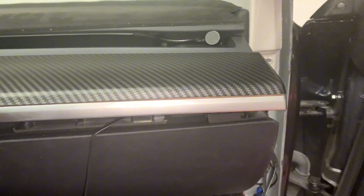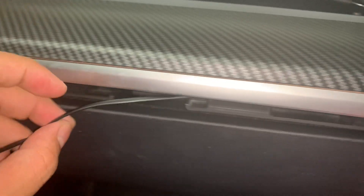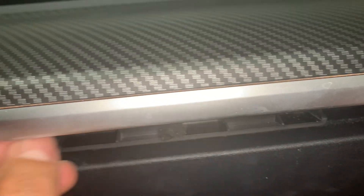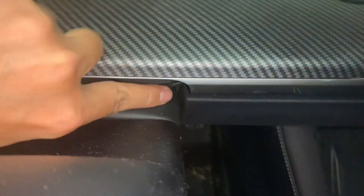For those of you who have never done it before, it is super easy, I can assure you. Now it's just cable management because we want our cable to be completely hidden — that's the reason why I popped that dashboard. I'll go ahead and hide it underneath, get in there, and then pop the panel back in. I'll make it crawl across behind the touch screen all the way to the other side. You can see the cable underneath this panel, and we're going to go ahead and secure and click all this through perfectly.